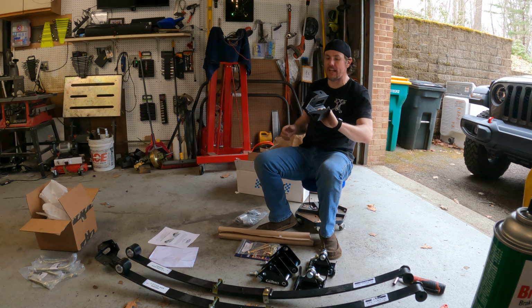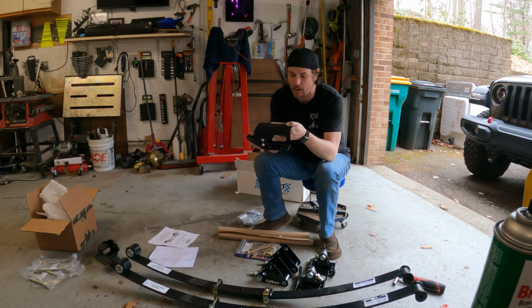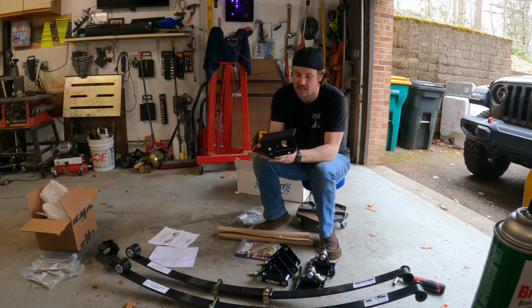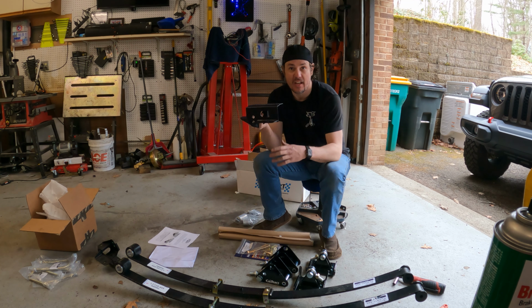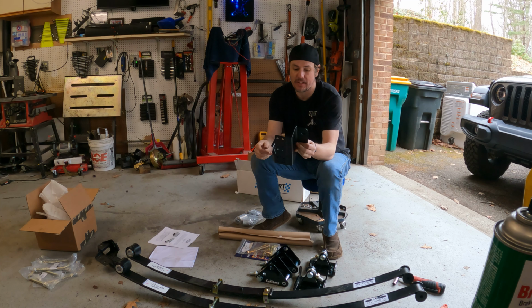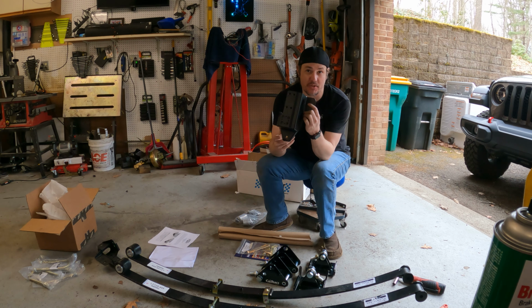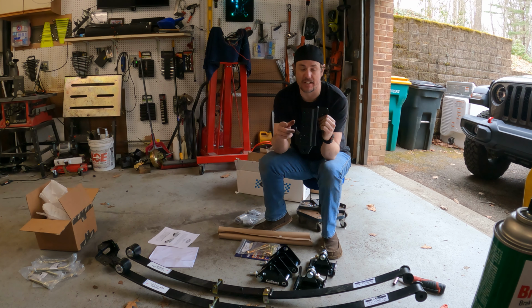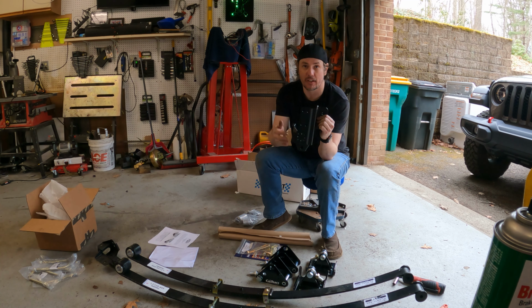Now, the big thing about our plates, we have to install these on the leaf spring before these go up in the car for a couple reasons. We need to install these so we can hang the leaf spring from the rear shackles, and from the two J-nut locations, which are going to be this one and this one. There's three stock. We're using two of them for this. We get rid of the one that's over here because we're running all the extra hardware through here. We don't need the one over here.